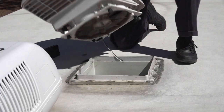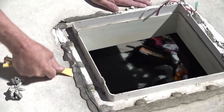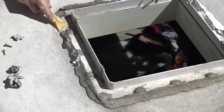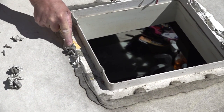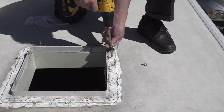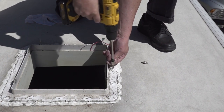The first step is to remove the existing roof vent. You want to carefully remove all of the old roof sealant. If the roof has a rubber roofing material, be careful not to tear the material when removing the old sealant. I use a plastic scraper to help get the old sealant off. With the old sealant removed, you can remove the screws securing the vent to the roof.